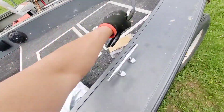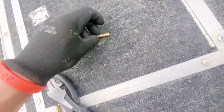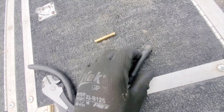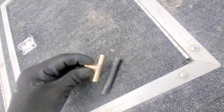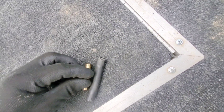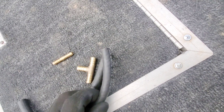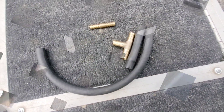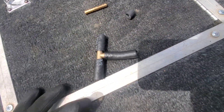This is the adapter to go into the smaller hose, and this is the original hose. When I install this brass T-fitting it's going to take out about an inch, so I only need two short pieces of the new fuel line. I'll go ahead and do that — I've got everything with the new hose in.